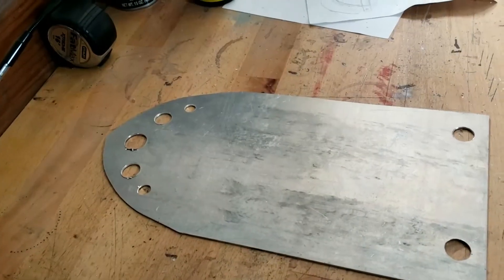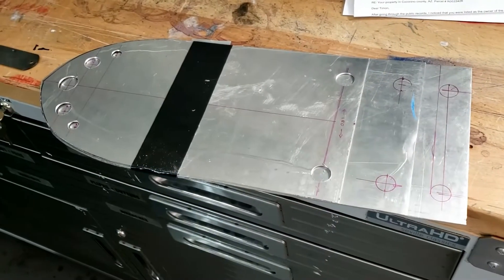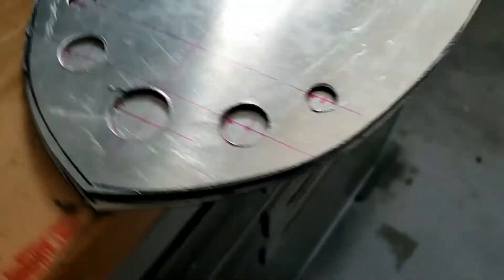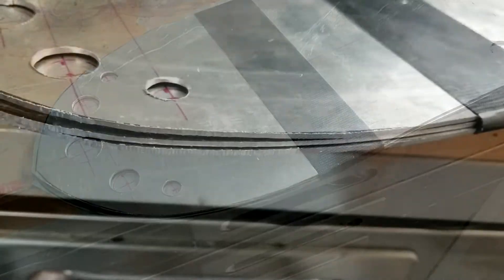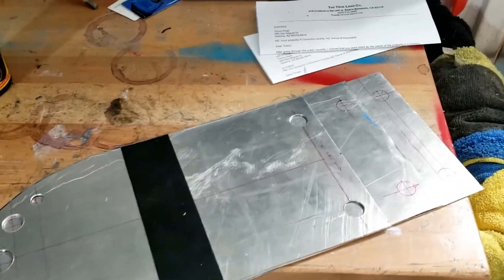The reason I like the idea of plastic is it had the same kind of flexibility as this gauge aluminum, except it was thicker. Before I go any further with this, I think I need to investigate that material from Home Depot. Carrying on regardless with the aluminum sheet — I've cut out three now and I haven't drilled the other two yet. To maintain some consistency in the curve after the cut, I've actually taped them together with a bit of Gorilla tape, and put them on the grinder together. That wasn't a half bad idea — it kind of works.